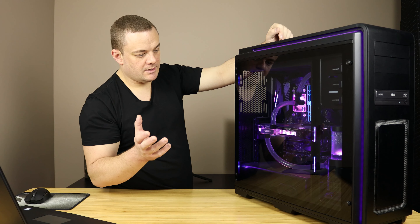I'm going to vent the system by removing the top off the reservoir so air has a place to get out. A top vent on the rad would be ideal but I don't have that. I'll open up the valve on the spigot and watch the coolant drain into the bucket. We haven't got all of it, so we need to tilt the case a little bit to get the rest draining out — tilting it one way then the other.